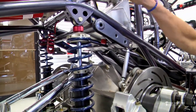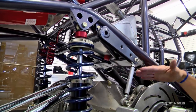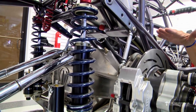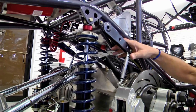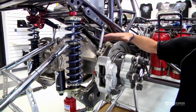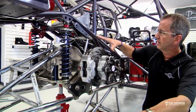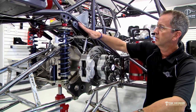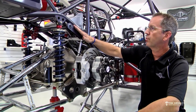You want to tie the mounting in where the shock is, where there's gusseting available. The anti-roll bar is used to keep the centerline of the rear end housing parallel with the chassis — it keeps the chassis from rolling over on the housing. Without it, there's more roll in the four-link because all these are on spherical rod ends, so the rear end housing can pivot side to side out of alignment with the rear cross members. It's a very important part of the rear suspension.